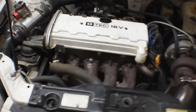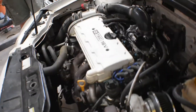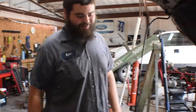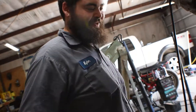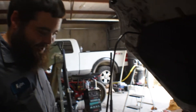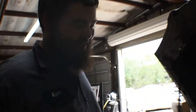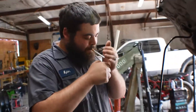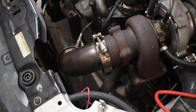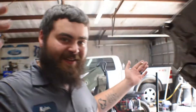We're gonna try to make this thing like an 800 horsepower car. The current plan is to pretty much have the stock power of like an STI — stock boost — and then go beyond that. That's why we're going to throw forged internals in, so we don't have to worry about the bottom end, and get better boost at proper times. It holds 12 PSI no problem, but we want a little more than that. Sooner or later we'll throw 26 PSI, film it, and if it blows up it blows up — if it doesn't, hell yeah brother.